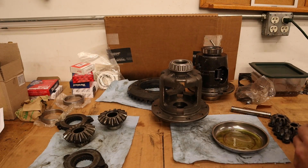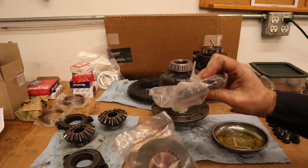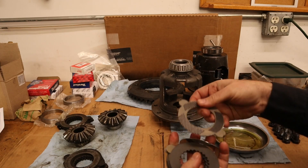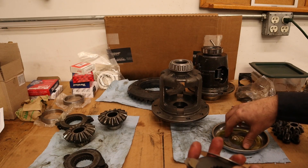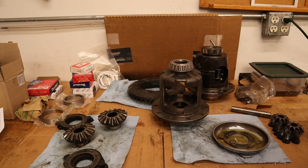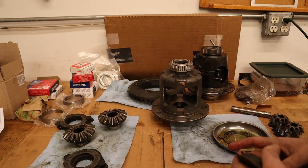To start with the clutch packs, we need to soak them in a friction modifier. I've got a little bit of that in a container here. The clutch packs do come individually wrapped, so we do not want to mix these up at all — they've included the correct shim. All we need to do is soak the ones that have the friction material on them for 15 minutes in this modifier. I'll do each of these individually because I don't want to waste too much of the friction modifier. I have another one of these which will go into the differential — this one will be thrown out.